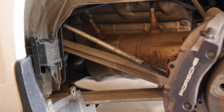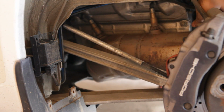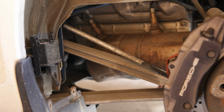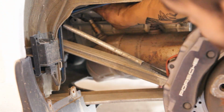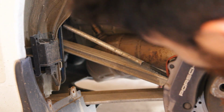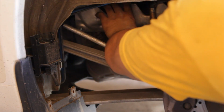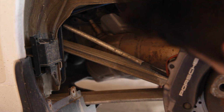Now I have to get those heat shields off. We got, looks like there's a bolt here now, and then bolt there, E10 Reverse Torx. So I'm gonna do like what I did on the last one, is just try to pull it over the lower heat shield, and hoping that I can set it down. There you go. Oh, access. Alright.